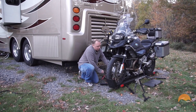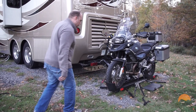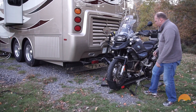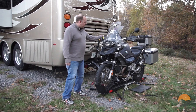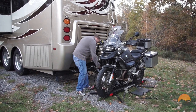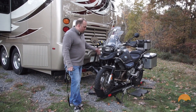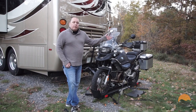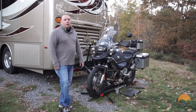I'd recommend you get the main secondary strap started a little bit and then look at where your bike is in terms of its straightness or level. Alternate between each strap and compress the suspension down to what is most appropriate for you. Once I've got the initial straps tied down — the bike is gently secured — and I've got my two main front straps on, I'm going to remove my helper strap carefully. Then I'll raise the CruiserLift up to about three quarters of travel so it's easier to access and tighten straps, add rear straps, and verify the bike is level resting on the coach suspension.